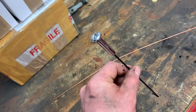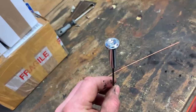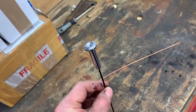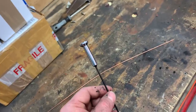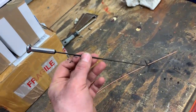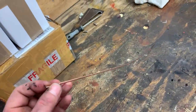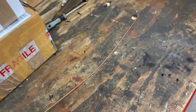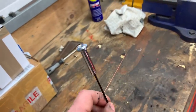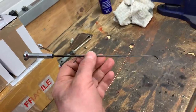The other little job I've done today is made two of these — the pins that open and lock the door from the inside. I got them off eBay, I think it was £22 for a pair. If I was going to stick with originality these should be black, but I'm a sucker for chrome, so I couldn't look past these. I've made the little link rods — they're basically made out of 2.5mm welding rods for gas welding, which are really rigid in small sections. I made them the right length, bonded them into the edge of the pin, and they now fit a treat.